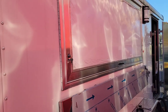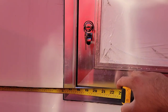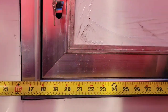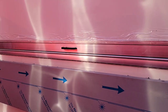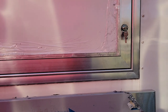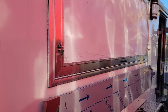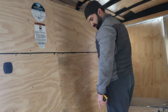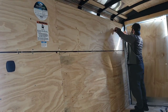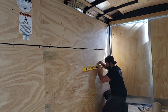Since we have the other trailer cut out already, I can use it to verify measurements. Going from the edge of the trailer to where the window starts, I'm at about 16 inches, and to the other side of the window I'm at 96 inches. The lip measures an inch and a half, so going 96 and 16, take out an inch and a half on each side — that gives the exact clearance of the studs. Thanks for watching and subscribing to this DIY series — 'How to Build Your Food Truck' with me, Frank Balteras.